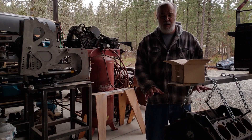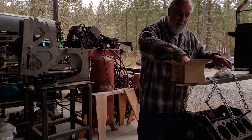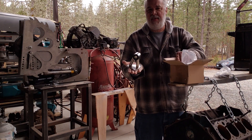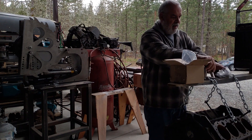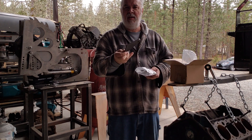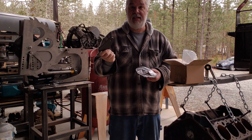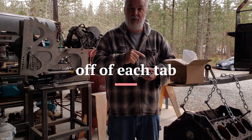I got my small block, just put the oil pan on it. Now we're going to put a stainless steel motor mount kit on it from Speedway Motors. The kit comes with a motor mount that will bolt onto the block down here, and then it comes with four tabs we will weld to the front suspension. If these don't work, fortunately we have enough metal, tools, plasma welders, and things here that we can make something. I'm hoping this will work right out of the box.